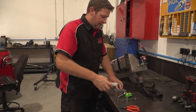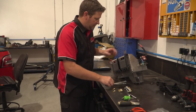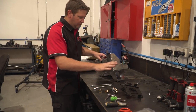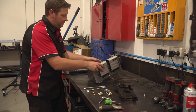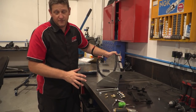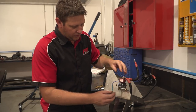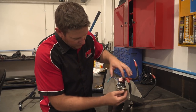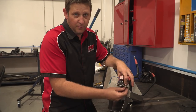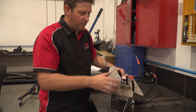We've got the install kit - we'll cut that open and make sure we've got all our fixings. We've pulled the drivers apart using an 8mm socket, quarter drive, and undone the injector drivers off the driver brackets. You'll see there's two sets of holes on the back of the battery tray. This tray is designed to fit both the facelift 70 series and the early 70 series. If you've opted for one of our full DIY battery kits, this is a good time to fit the Redarc SBI solenoid. Make sure the earth here comes around to the battery tray - you've got two 10mm nuts and bolts to hold that in situ. The bracket is slotted so you can move and flip the SBI solenoid around depending on wiring and what's in your car.